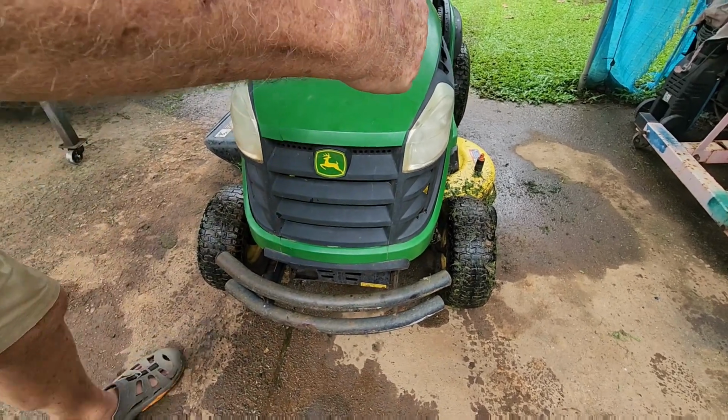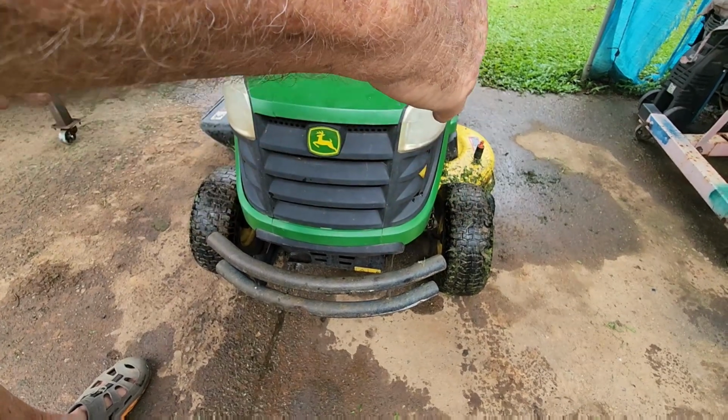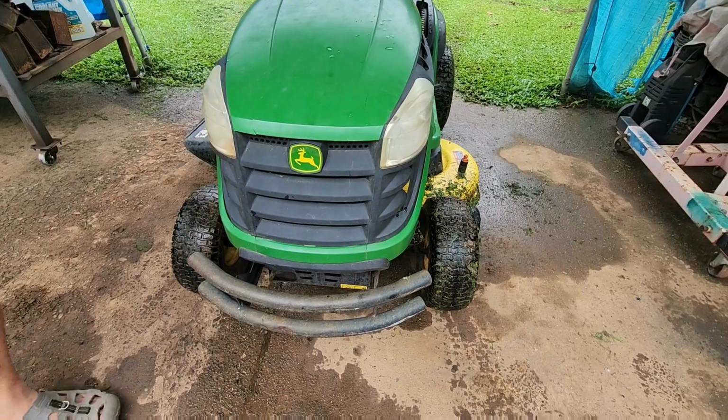Normally you have it slightly in, for track for these you can probably just have it parallel, but on a car you have it slightly in, called a toe in, which makes it easier to steer.